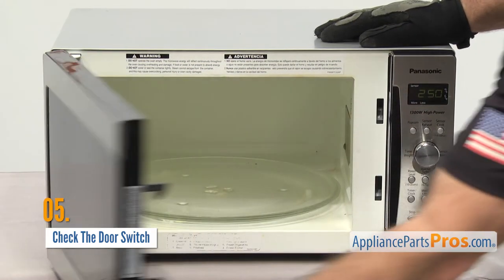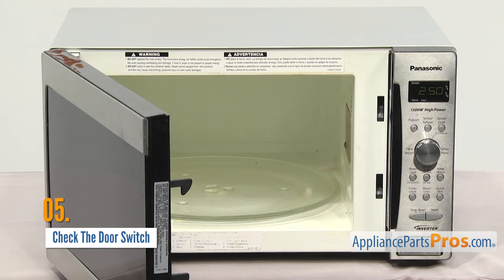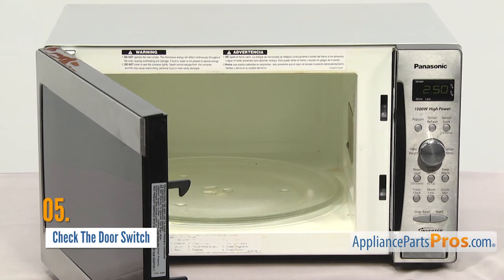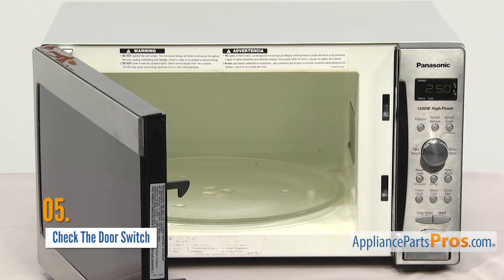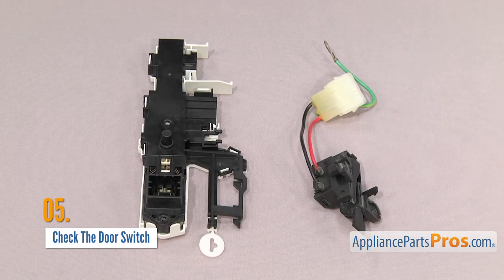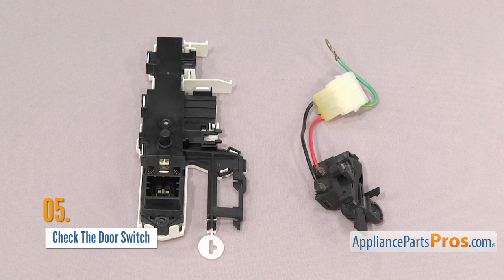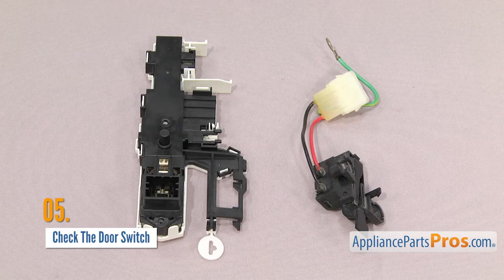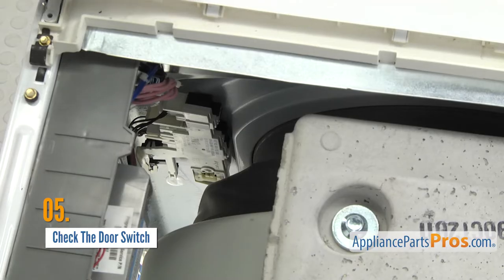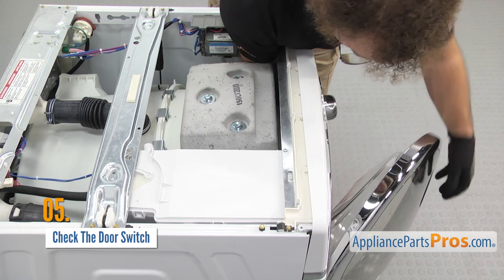Microwaves, for example, have two door switches — an upper and a lower switch installed in the assembly behind the control panel. If one of the switches has failed, it could also blow the fuse, meaning you'll have multiple parts to replace. If you're replacing one door switch on your microwave, always replace the other one too. On washing machines, there are generally two types of door switches. One is a basic switch that tells the washer if the door is open or closed, and the other has a door lock built into it. If the door switch has failed, the washer will think the door has been open and either won't run or will stop the cycle. For the other style, if the lock fails, it simply won't unlock. If you need to release the door lock in order to open the door, most front loaders have a manual release behind the access panel. If you have a different style, consult your user manual.